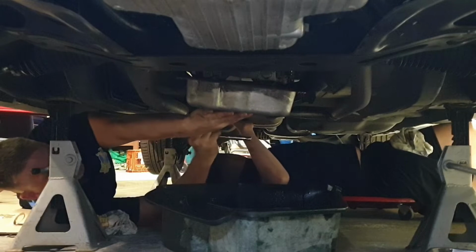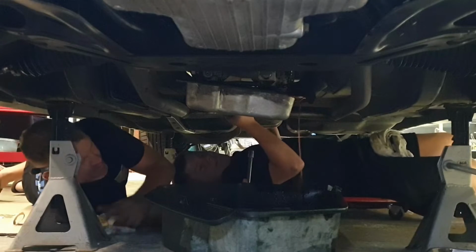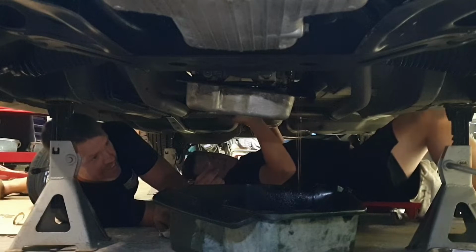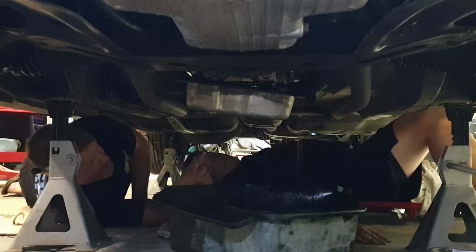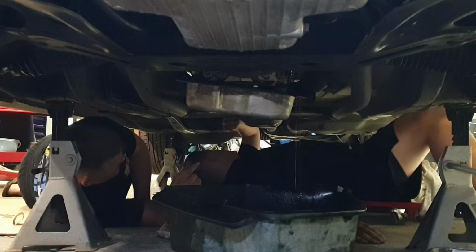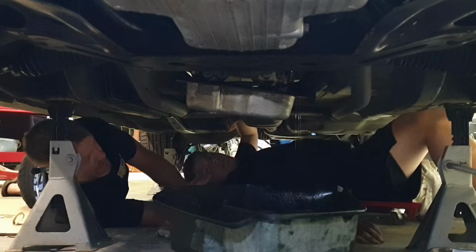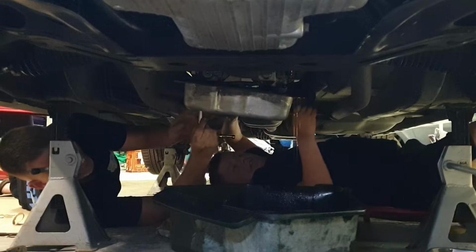Right, so what you do, you just gently unscrew the last one. Let's let it drain out a little bit. Yeah, I see that, Dad. Now, can you see how the transmission oil is still a reddish sort of maroon colour? So it's actually not too bad. And what's good is it hasn't got a tow bar. Because what happens when it's got a tow bar? You can tow things? What do you think we do with the Patrol? We thrash it, don't we? So what do you think happens to the transmission? She gets hot. Right, you hold the pan up.